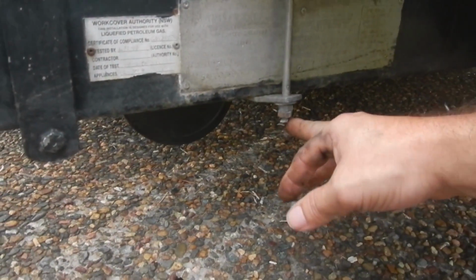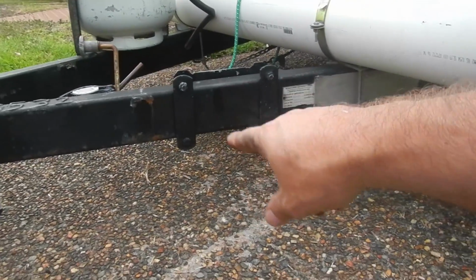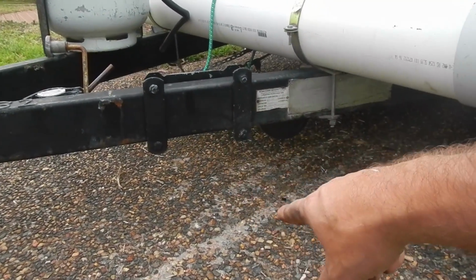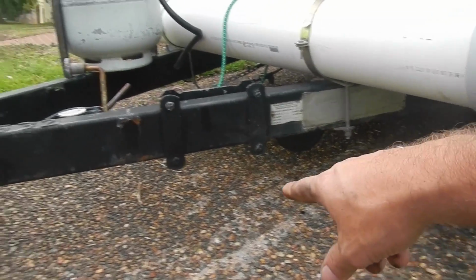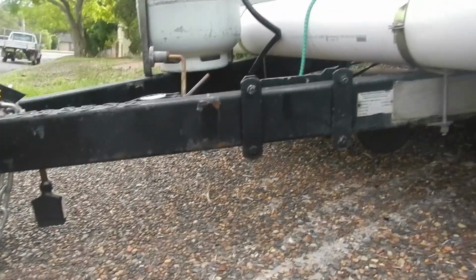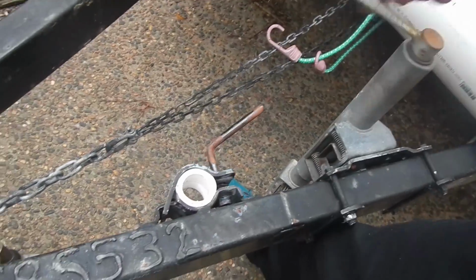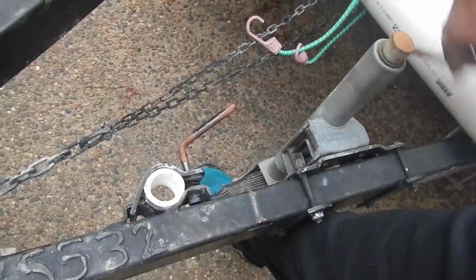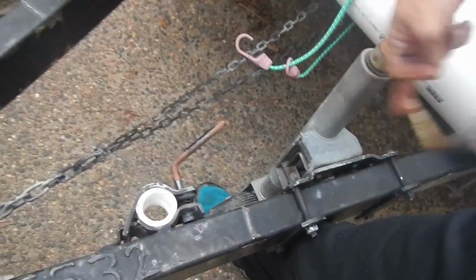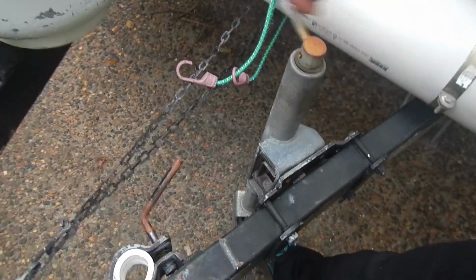These were some of the items that were touching down. It was a little bit longer, but we're still touching down. And our load leveler, as if we had those on, they hang down like a little hook, and they were catching all here as well. So you can see that's probably the 4 inches we've been talking about for where these have been touching down versus where it's at now. As far as conclusions go, one thing you can expect to do if you do a lift, axle flip, whatever you want to call it, is you're going to be doing a lot more of this.